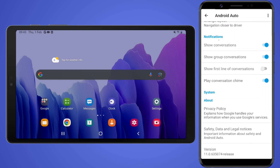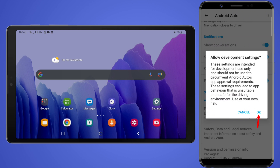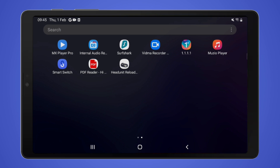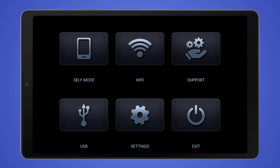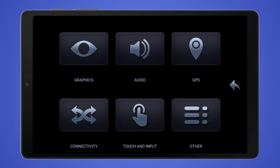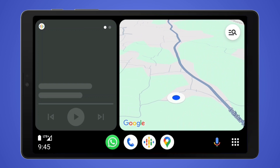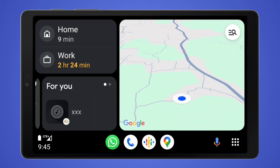Scroll to the bottom of the screen and tap the version number several times to enable developer mode. Once the developer mode of Android Auto is activated, tap the three dots in the top right corner and click 'Start head unit server.' Then open the Head Unit Reloaded app on the tablet, select Settings, then Connectivity, tap 'Wi-Fi connection mode,' and select 'Manually connect to Android Auto head unit server.' The Android Auto interface should now be available on your tablet.